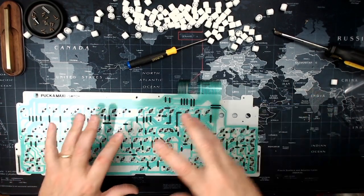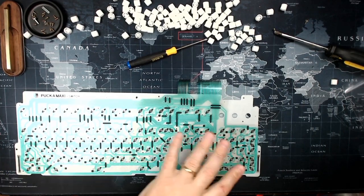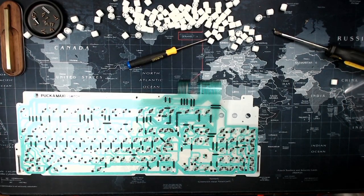So in KiCad, I want to make this layout with Cherry MX and Alps, and I'm assuming I can grab Hasu's library or whatever and put a whole board's worth of those individual switches in the right spots and spacing, and then clean up the rat's nest of all the traces so that it's as clean as possible, and then get some boards ordered. Sounds easy, but I know it's not.